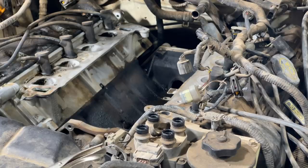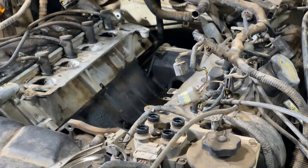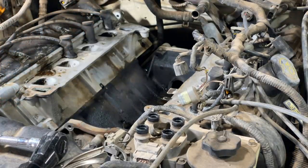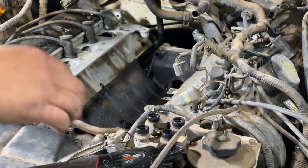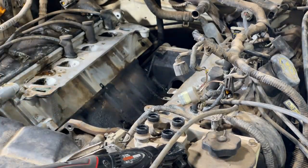Pulling the plug wires — there's a lot of goo, that's nasty. I'll lay the old plug wires next to the new Denso set to figure out which ones match which. Getting down in here to remove the first spark plug — this is a 5/8 spark plug socket. Wait — it doesn't seem to want to fit. Let me try again.